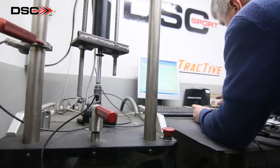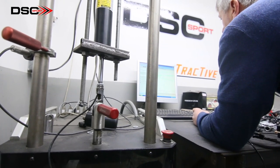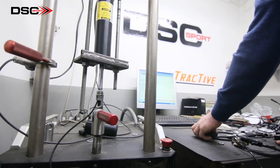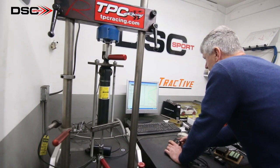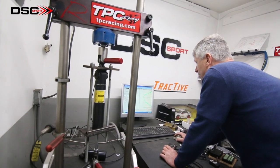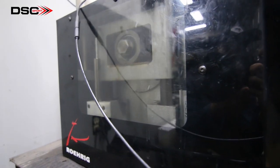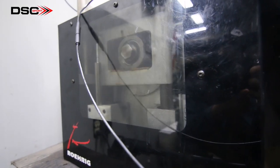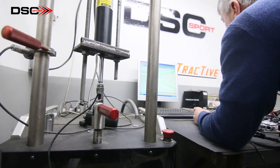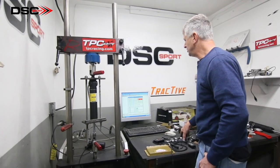You'll find out that there are two ranges. In some road racing or autocrossing, you might want to run the shock soft front and rear to have quick weight transfer. But on a road race track, you may want to have the front dampers come in before the rear so you can really plant the car on its front end and carry it into the corner. All of that can be done inside the DSC, and this is running at 10 inches per second at the end. So there are the two different control strategies.